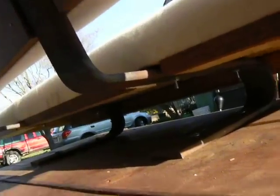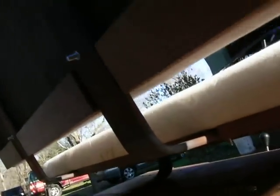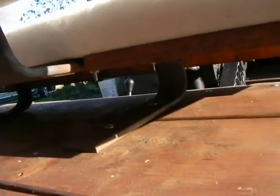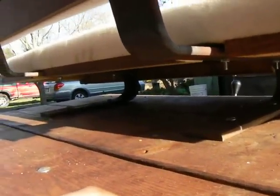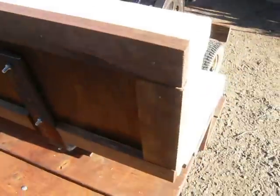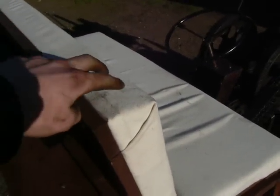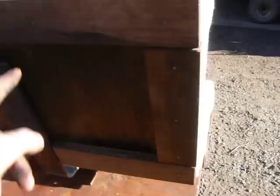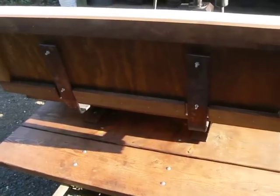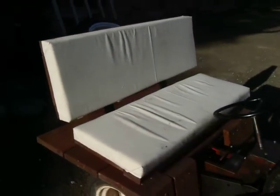To make the seats, I took two pieces of leaf spring and bent them into a combination seat spring and bracket to hold the seat back onto the seat base. They're pretty thick leaf springs, so they don't give too much, but they were free so I can't complain. I used three-quarter-inch plywood for the seats, two-inch foam, and some heavy canvas — wrapped the canvas around the foam, stapled it, and nailed on a border of wood to cover the ragged edge. The seats came out pretty well — I'm happy with them, pretty comfortable.